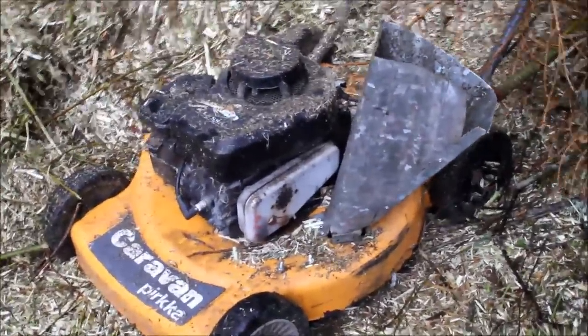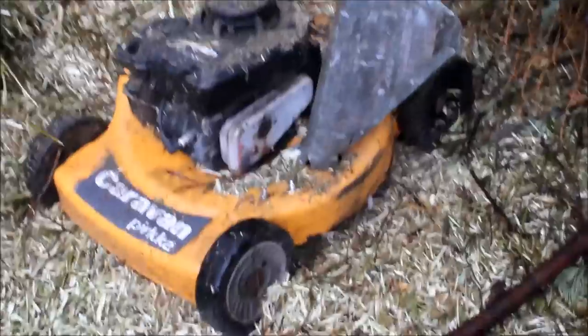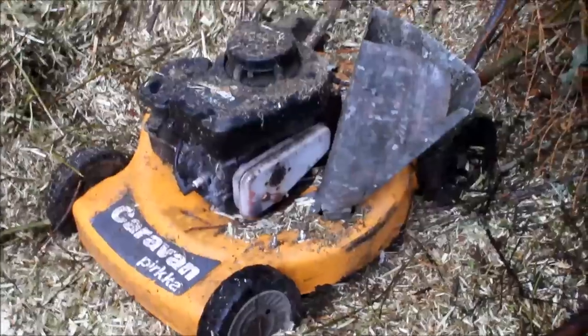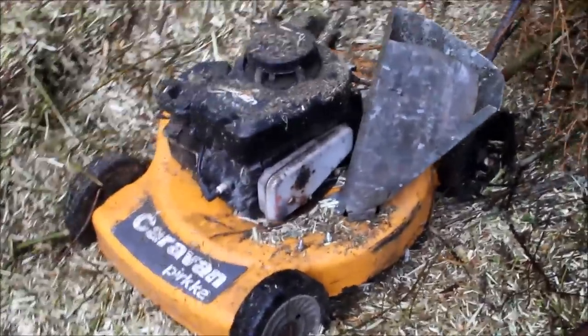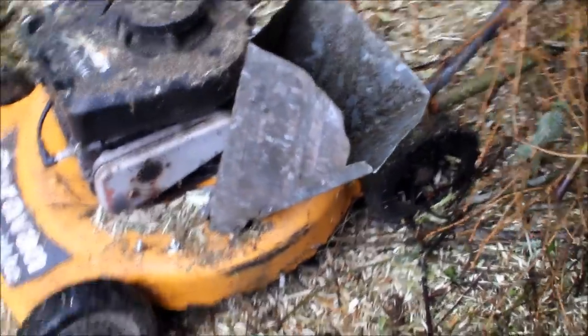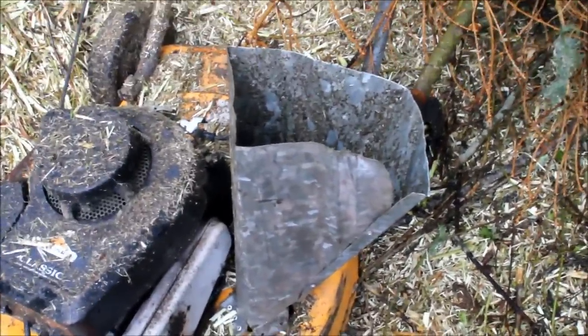You know, people try to just cut a hole to the case of the lawnmower and feed the branches through that. Well, it's difficult because branches get stuck to the edges of the hole. So it's just, you know, a simple matter of making a funnel of sheet metal and some pop rivets. It's really crude what you're looking at, but it works well.